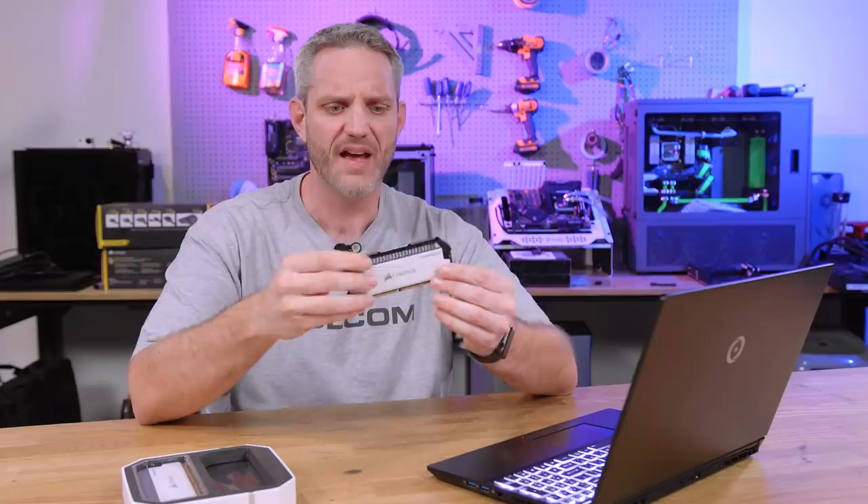I've done many videos saying: you went out and bought yourself some nice 3466MHz Corsair Special Edition memory, you plug it into a computer whether AMD or Intel, and it's going to run at 2133MHz — because that is the actual base clock of DDR4, though it may run up to 2400MHz out of the box. Which is frustrating, because really all you paid for is memory that's validated, tested, and overclocked to run at that particular speed and those timings printed on it.